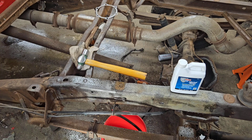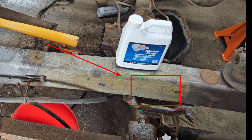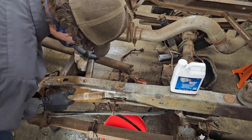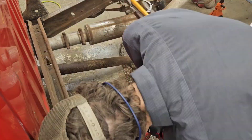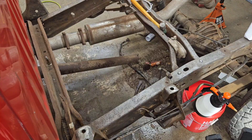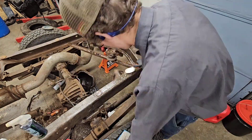Overall, I am very impressed with this product. However, there are a few instructions on the back of the bottle that are not very clear. One thing I experienced — which may not even be on the back of the bottle — is that the frame is yellowing, and that is due to corrosion from the acid drying. One way I have learned to prevent this is by blowing it off with compressed air, which seems to be the only real effective way of keeping the frame from corroding. You can see I am wire brushing because the frame decided it wanted to corrode. I know a lot of you will comment about water causing the corrosion; however, the instructions do say to rinse off the acid with water. So one thing you need to do after rinsing is blow it down with compressed air. Other than that, I am very impressed with this product.